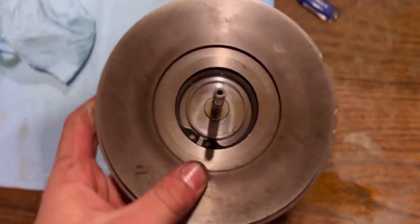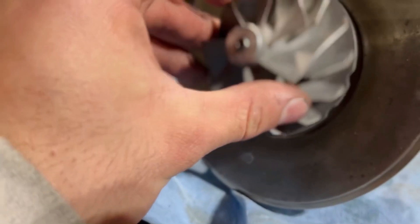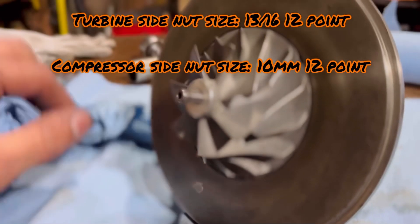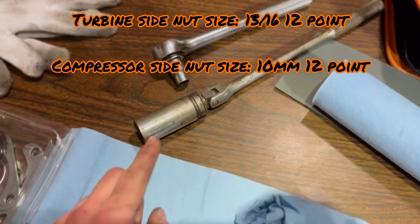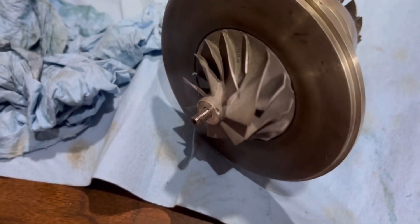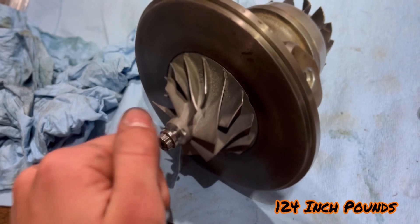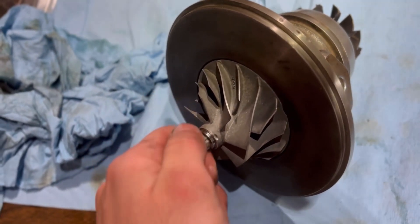Compressor going on — very straightforward, right over the threads, slides in. Now the back is normal thread and the front is reverse thread, so you're going to take two ratchets and snug it up. The torque spec for this nut is 124 pounds, I believe, for the 12-point. You can put Loctite or something like that on this nut to prevent it from backing off.